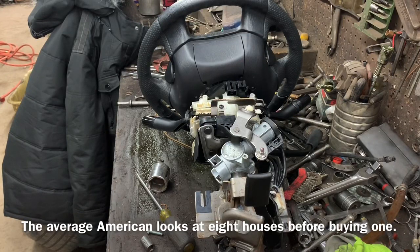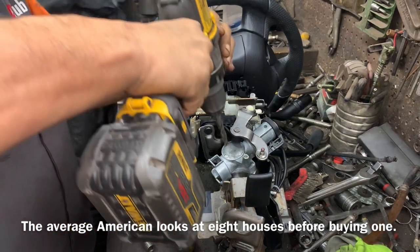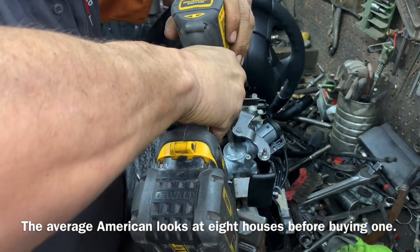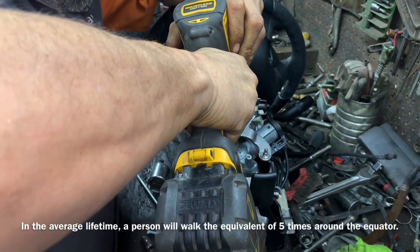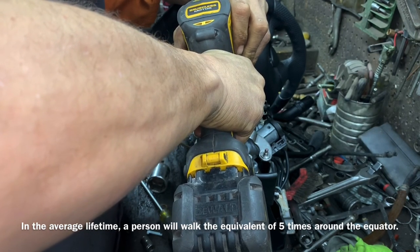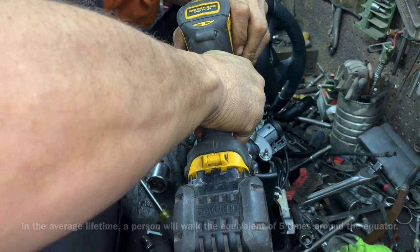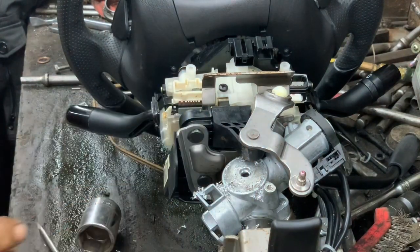Hopefully you're watching the video before you remove this thing. I'm going to try to drill out the lock here that's locking down the steering, because I can start the vehicle and shift it but I cannot turn the steering wheel. I tried drilling into it — that did no good whatsoever. Even drilling right in the center of this thing it still wouldn't release the lock.